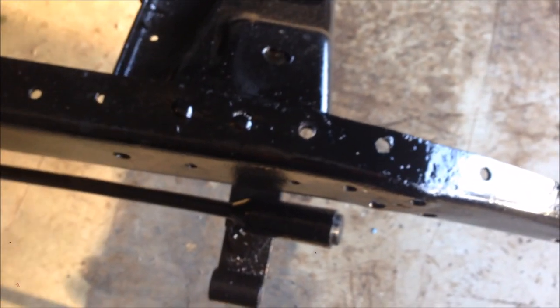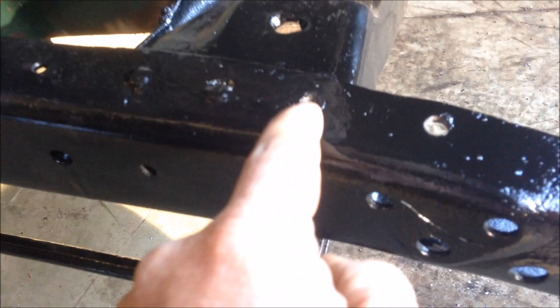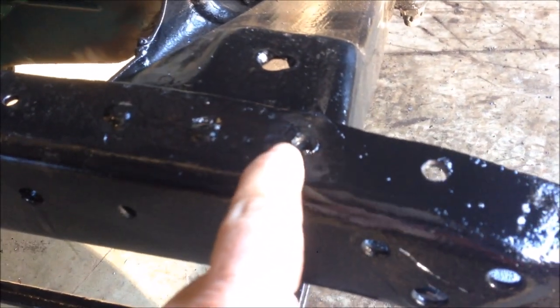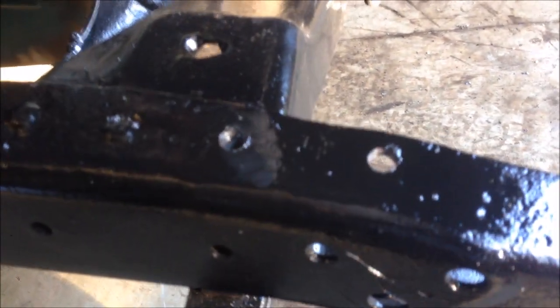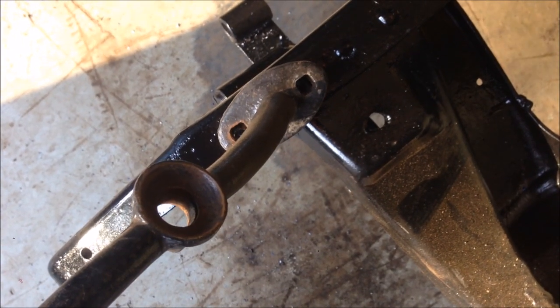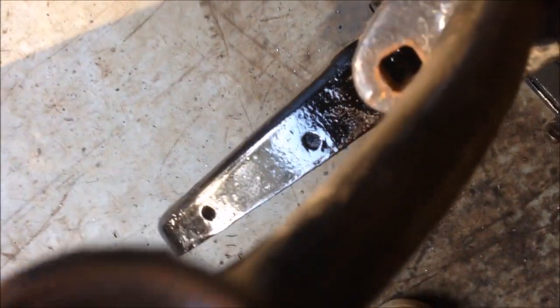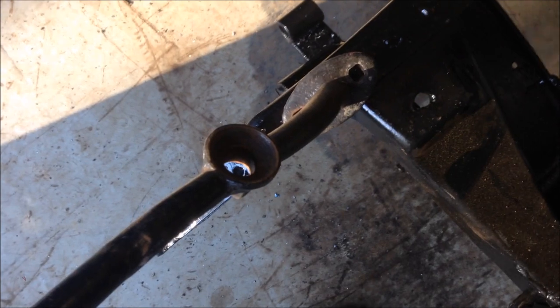You don't even need to drill holes for this. On your front horns you already have the holes — that's where a rivet would have been for the front crossmember. I've enlarged the holes a bit for my bolts but they're factory holes, which is another little bonus. So imagine you've cut it in half — these holes line up. You bolt that down to those two holes and then, using the leverage from the long bar after heating this section, you can use that leverage to bend the top to the desired position.